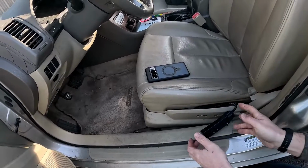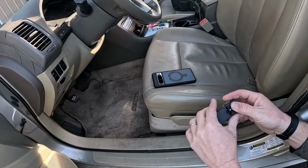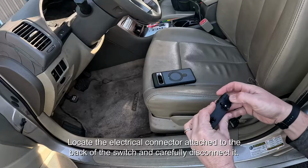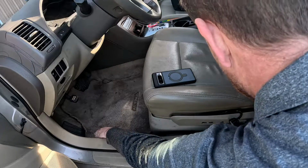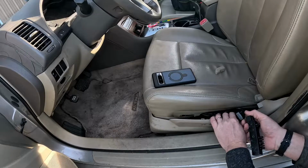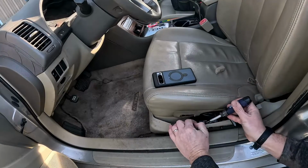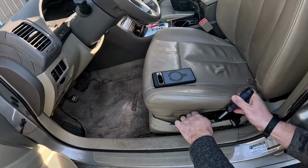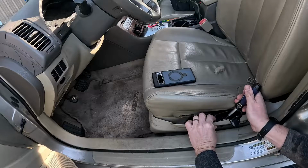We dealt with a similar thing with our Ford Expedition, but ultimately you get this control module, and what was happening is this side couldn't get to go back. That worked just fine. All the other controls worked, so it wasn't an electrical issue. And here's the other piece that we had to pull off. You have to pull those two off, and then I was able to pry them out here. So it'll pop. Okay, so you come in here, pry that one up, pry that one up, and just push from this outside, and that'll help a lot.